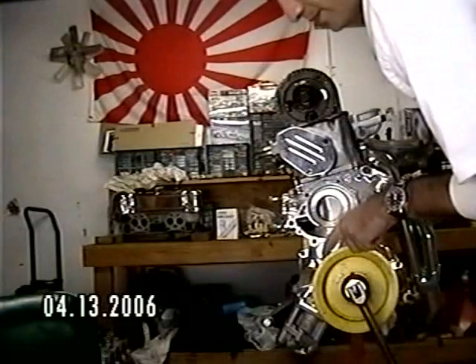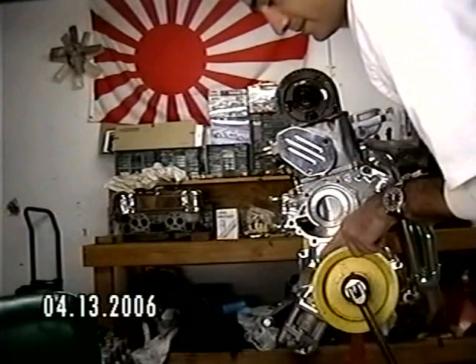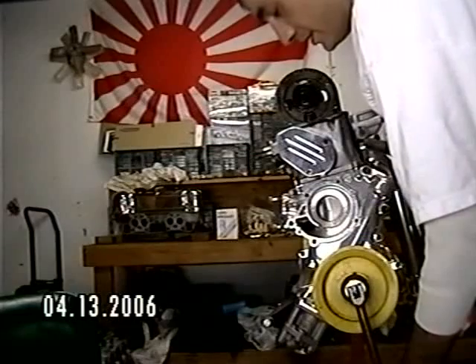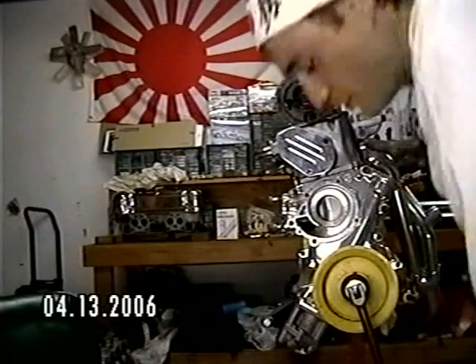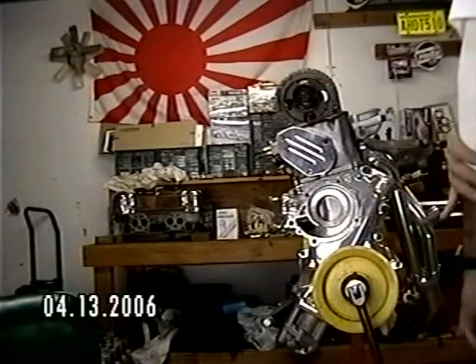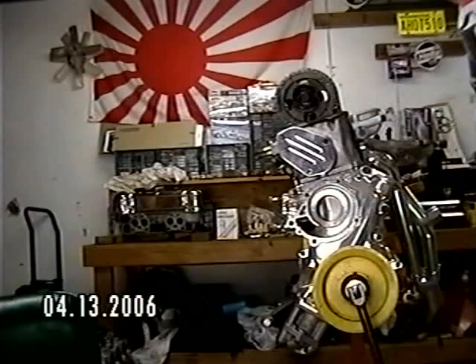On an L16, the marks are 20, 15, 10, 5, then we come up to zero. If you're coming up to a broken motor, this is one way to check it out — see if everything was lined up correctly, including the distributor shaft and everything.